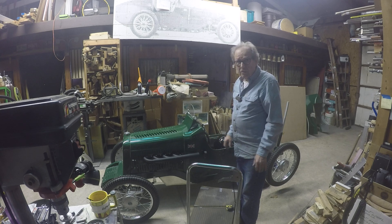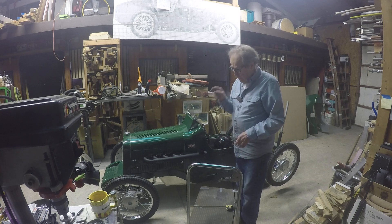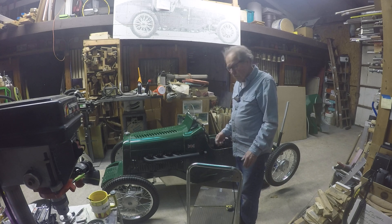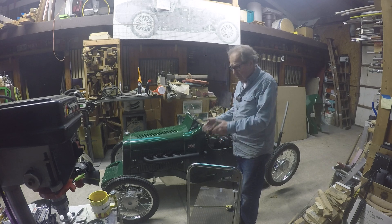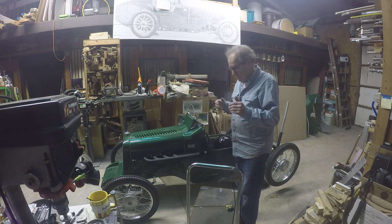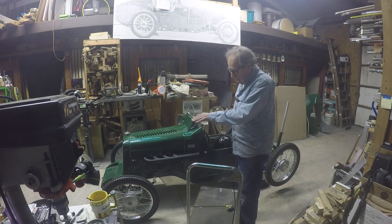You don't see it very often with the two-post lift — it's not quite as stable. But the two-post lift has a big advantage in that you can service the wheels, the axle, all the suspension relatively easily, because everything is just hanging off the middle. The guys are buying motorcycle lifts and suggesting you use motorcycle lifts. Well, those are fine, but they're a four-post lift, or similar to a four-post lift, where you're supporting the vehicle on the tires.